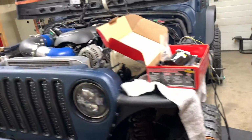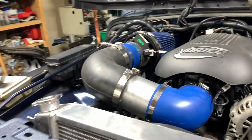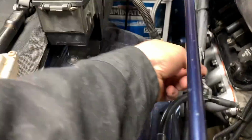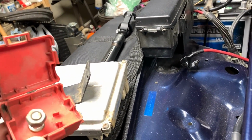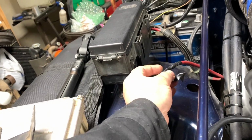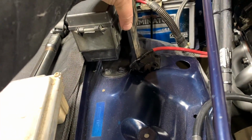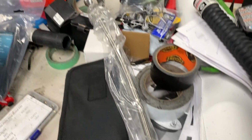All right, in the last video I talked about I'm running out of real estate. I need to figure out the oil filter, and I still got this alternator wire that has to stretch over here because on the TJ, of course, the alternator was right here, and now I took this off of the engine in the junkyard. This hole will have to be drilled out a little bit there, but I got the plate here, and I need to cut those ribs and then bend it at a 90 so we can go there. I can mount that, and then I'm thinking about the fuse block there, and I still haven't figured out the computer mount. But since things are getting pretty tight in there, I still got the transmission dipstick to install.